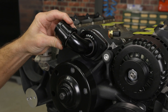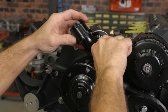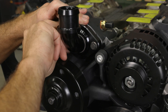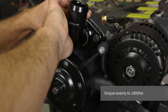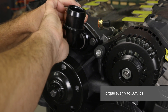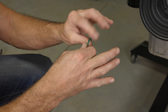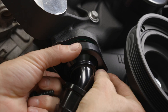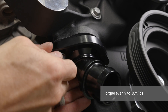Place the water neck and flange you selected over the thermostat, then secure it with the two M8x30 flange head bolts. It's important that the bolts on the water necks are tightened and torqued equally — this prevents the neck from binding, which can cause damage to the neck or coolant leaks. Before installing the water neck on the lower inlet, lubricate and install the O-ring into the groove, then install the neck and flange, securing them with the M8 bolts and torquing evenly to spec.